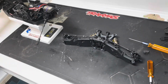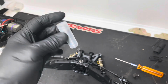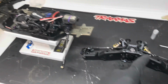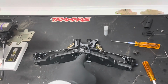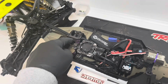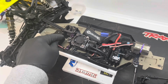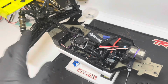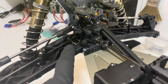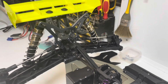Right, so next day, and we have bearings. So recap, last night needed a back bearing there, didn't have it, so I went ahead and rebuilt the centre diff, new bearings in there, new oils, all cleaned out, and then I went on and put the lightened out drives on the rear end. So that is all done.